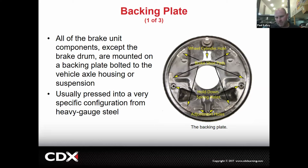So to simplify it, we're probably going to use the typical disc brake caliper lube, like that purple ceramic stuff, or even my favorite, the silicone paste. And so, Renee, the answer on anti-seize: it can't touch anything rubber. So disc brake guide pins, no. Drum brakes, maybe fine. It could be fine. So if you see somebody put anti-seize right here, that's legit. You just never want to put anti-seize on disc brake guide pins with rubber in them.